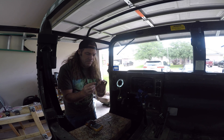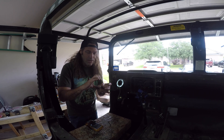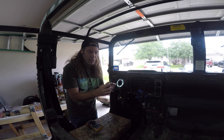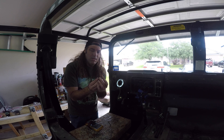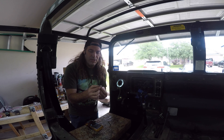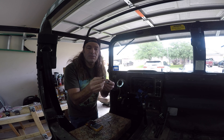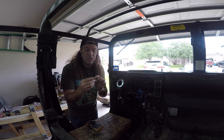What I did is I actually took that center piece — the way that thing worked is it had aluminum on the outside and then a center sleeve isolated with nylon or silicone that basically kept these two separated, so the outside and the inside did not touch and it was not a continuous circuit. When you pushed, it had a plunger that would essentially touch the center piece and completed the circuit. So what I did, I took that piece out, kept the rubber grommet and the male pin, cleaned everything off, cut the outer edge off, kept the nylon, and made a big bead of solder down the middle. Then I took a wire with a clip that matches my horn pin and soldered it down the center shaft, being sure that it doesn't touch anything on the outside.